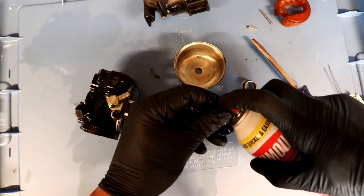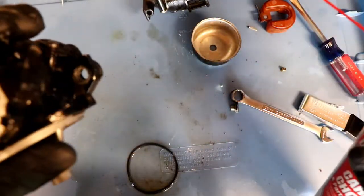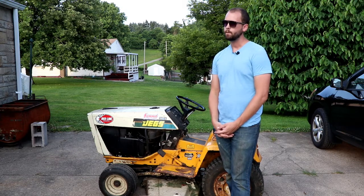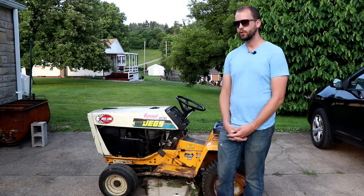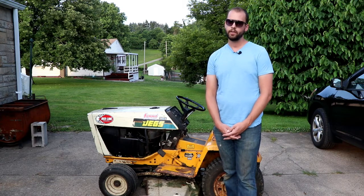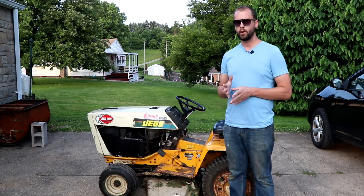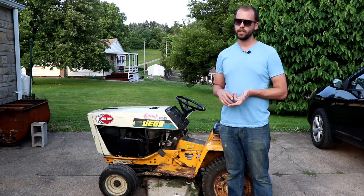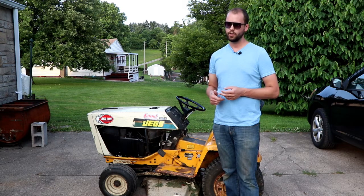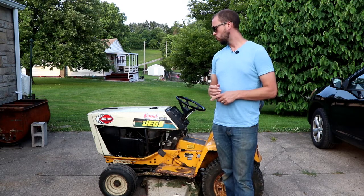The really big thing is your main jet — a little brass nut-looking piece with a hole in it. Make sure that's super clean, then spray all the way through beyond the main jet into the main air tube to get that fuel pathway clear. What's crazy is you'll pull the carburetor apart and think it looks perfectly clean — there's no way this is the problem — but nine out of ten times you clean it, put it back together, and it runs perfect. These carbs can get varnished over with a film that makes them just a little more restrictive, and they're so sensitive to that fuel-air ratio that even slightly less fuel for the air going in will make the motor run wrong.